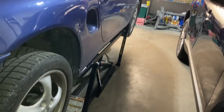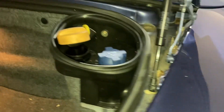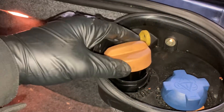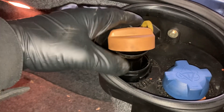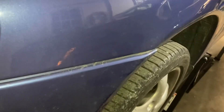To begin your Boxster oil change, you're going to want to jack it up — quick jacks or jack stands, whatever gives you enough room to shimmy under the car. First thing you're going to want to do is come back here and pop your oil fill cap off, and just kind of leave it covering but not sealed to allow air to get in there and fill up the volume so your oil drains nice and smoothly.